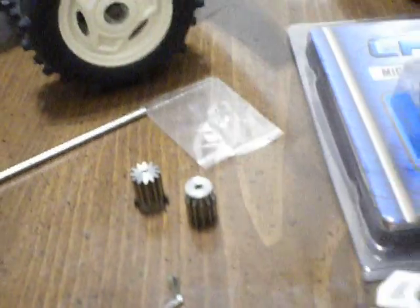I've got a drill bit and I drilled it out. I haven't quite finished it — it's about halfway drilled out, but it's going to work fine. My drill bit broke, and I just got through tapping it to get the broken piece out. This particular pinion is a double grub screw, manufactured by RC Four-Wheel Drive — a steel 32-pitch pinion gear with double grub screw. I just need to finish drilling it out, then do the same to the other one.